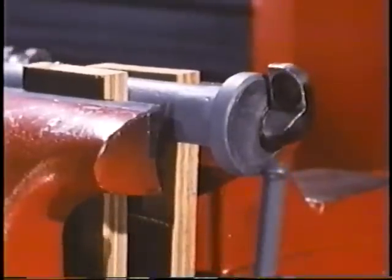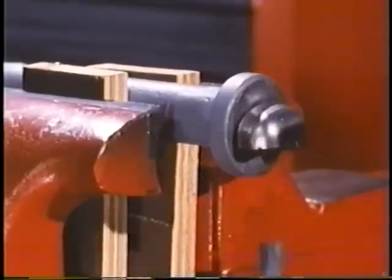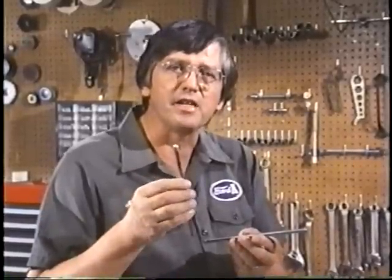When the brake lever is pulled, it turns the shaft, and the pawl at the end of the shaft presses downward on the little push rod. It travels through the center of the kingpin, forming the link between the shaft and the front brake operating wedge. Here's an original, and here's a reproduction. It looks nice, has the rounded balls on the end, and it's the right diameter. Only one problem — it's not the correct length. It will not work. The correct length is 7 and 3/16ths of an inch.